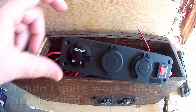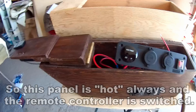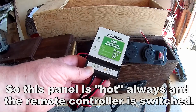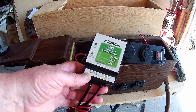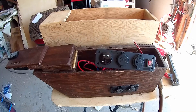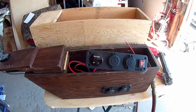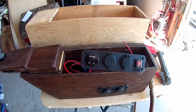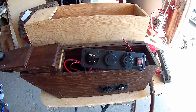I'm going to use this as my on-off switch — it will tell me what my voltage is. That's going to be my on-off switch for my load. The controller itself, I'm going simplified and going with the original one that came with my 50-watt panel. The whole system is going to be just a tiny bit simpler, and I'm really hoping it's going to have a lot more staying power. The amp hours rating on the new batteries is about 18 amp hours, so the two of them in parallel will still be 12 volts and give me 36 amp hours, which is a fair bit of backup juice.